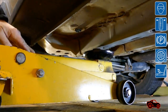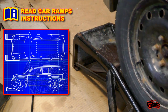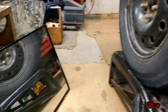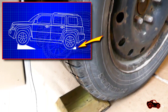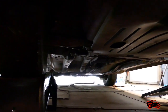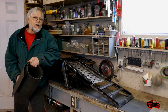Personally, if I have to work under the engine or change the oil, I prefer to use car ramps. First, I position the front wheels straight ahead, then I place the ramps well aligned with the wheels. The vehicle must be slowly driven up the ramps, then the front wheels are safely stopped in place. I often use a mirror to know where the front wheels are located on the ramps. An assistant can also guide the driver if the ramps don't have proper stop walls. Even on ramps, safety is important, so I always block the rear wheels with wheel chocks. When the work is completed, I remove the wheel chocks and any objects left on the ground. Then, when the area is secure, the vehicle can be slowly removed from the ramps. Car ramps can slide on surfaces like epoxy, so I use rubber mats to keep them in place whenever I drive the vehicle up.